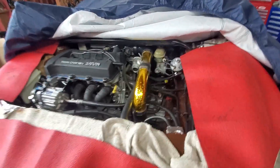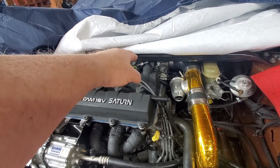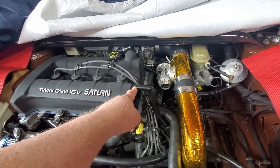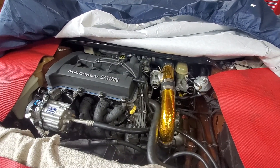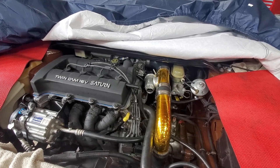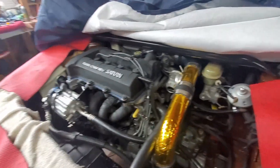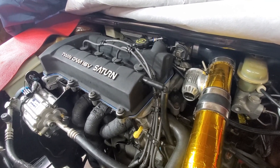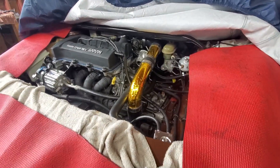The STS guide says for a MAP car, all you need is a vent filter. Not wanting that — vent filters get dirty and clogged, stop venting like they should, and some drip oil. Any vapors coming out look like you've got an issue under the hood, which is embarrassing. So I wanted to install a catch can, and I did. I added Scotch-Brite chain-mail-style media inside — the gases flow through it while the mesh knocks oil out of vapor suspension and lets it settle to the bottom.